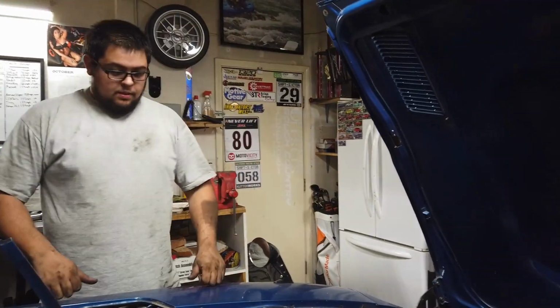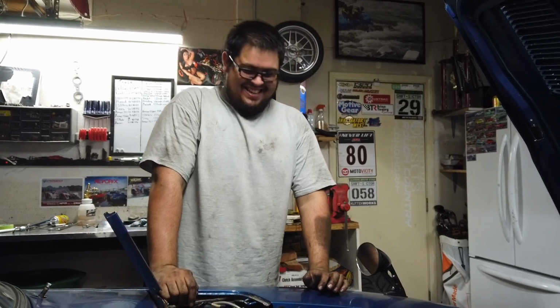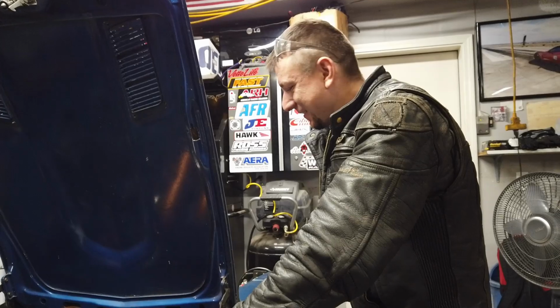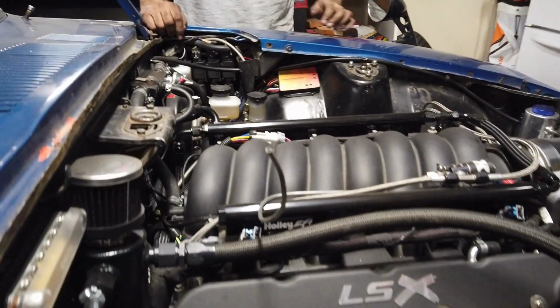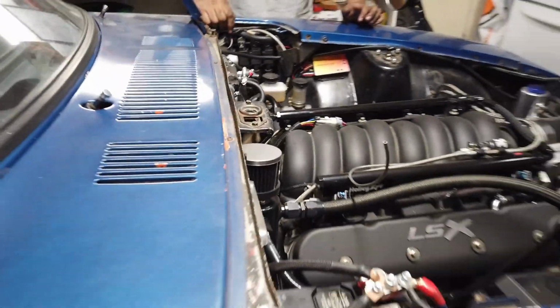We bled the brakes. They're bled. They are at my level of comfort. You know what it is? I think I get spoiled at work because it's all new cars, like Z01 and stuff. You have that instant bite just at the very top, whereas there's no bite at the top here. And here's my theory, and you agree as well. That's not enough master.